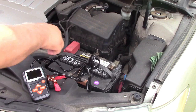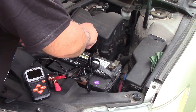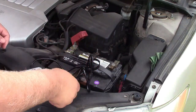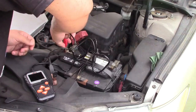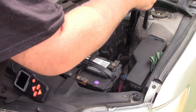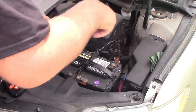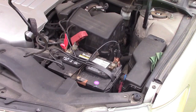Operation is really easy. If your car has a little cover over the positive, which a lot of cars today do, you take that off. Put the red to the red, the black to the black — it doesn't matter what order you put them. Clamp that on there, and the screen lights up.